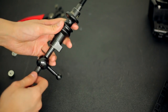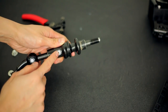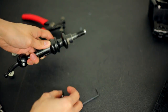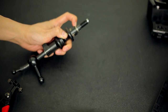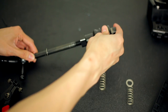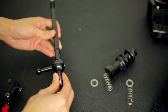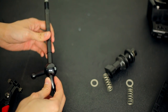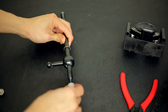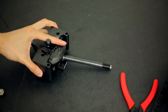For the Boomba short shifter, you need a pair of snap ring pliers to get the snap ring off the short shifter. You also need to remove this bolt to get the reverse lockout off. Once the reverse lockout bolt and the O-ring are removed, you can take the springs out and remove the reverse lockout. Grease up all the ball joints with white lithium grease before you install this into the shift assembly. Once all the ball joints are greased up, transfer the shift adapter from the OEM shifter onto your Boomba shifter, then reinstall this back into your shift assembly and get the reverse lockout back on.